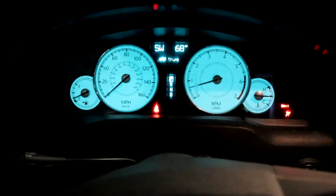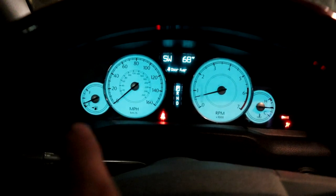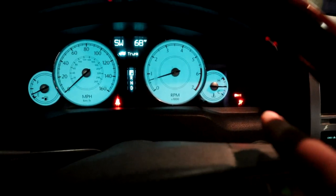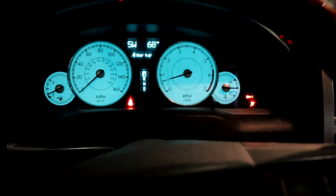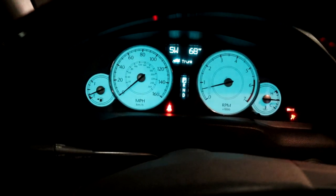That oil pressure sending unit sensor is a pain in the ass — I'm impressed with anyone who could ever get that thing out. But if we get in the car right now, there's no check engine light, no throttle light. The airbag light is still on — I haven't figured that out yet, but that's coming. I need a different sensor to figure out what's going wrong with the airbags. We fixed everything by doing nothing more than jiggling some connections. While it might be a little disappointing to have replaced literally nothing, the car is fixed and I have spare parts in case I ever need them. It looks like whatever accident this car was in, it either jogged loose a couple of connections, or people at the salvage auction opened it up and jiggled everything loose — so you just had to go reseat these things. It ended up being fine, which is pretty cool especially for as old as this motor is.